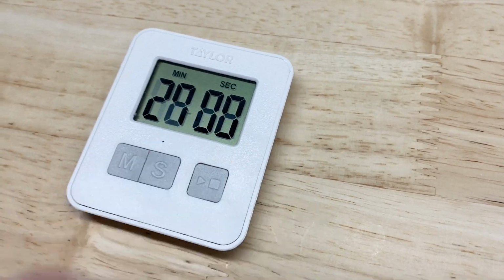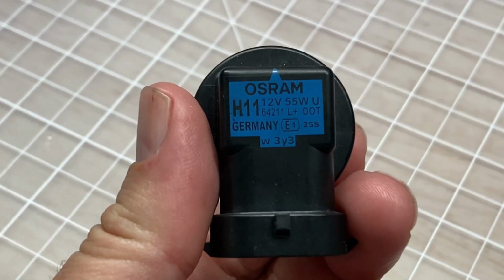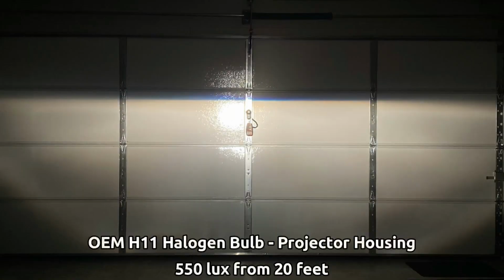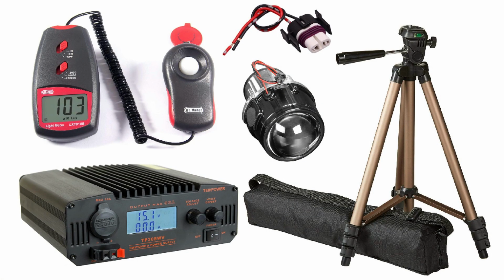I measure initial brightness and then again after 27 minutes to see how the heat impacts the light output over time. I use 27 minutes because that's the average commute time in the United States. My tests aren't for lux number accuracy, but for comparison to a stock H11, which measures 550 projected lux and 910 reflected lux when performing the same test that I will on the light featured in this video. And if you want to do the same tests of your own, I put a complete list of the equipment I use in the description.